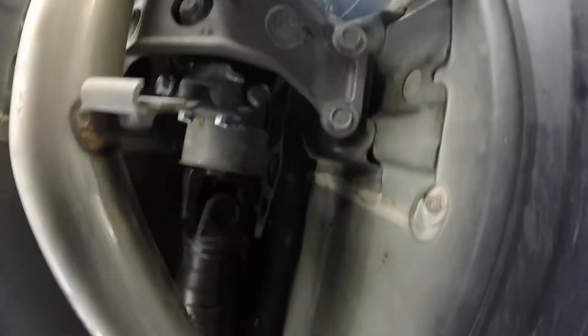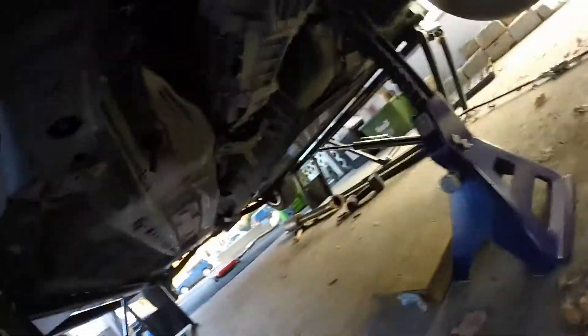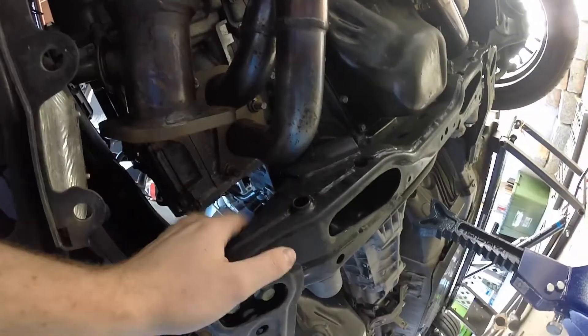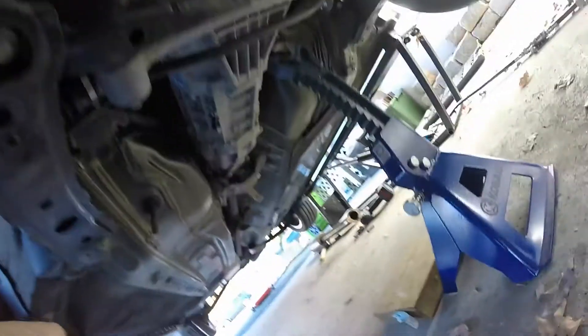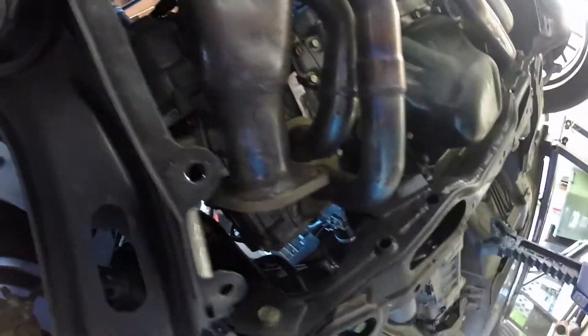So we're gonna pull this off and then we're gonna have a little fun and start it with just headers. Quick update — I'm gonna show you the temperature. I've got the jack stand sitting there. There wasn't enough clearance once I disconnected that bolt to pull the pipe out because the flange was hitting on the motor and the K-member. So we had to actually jack the motor up a little bit, which I did redneck-style with the jack stand and the lifts. Once we got enough clearance, we were able to wiggle it out. Now we put the motor back into its position because we're gonna start it with the open headers and see what happens!